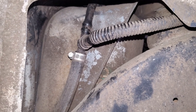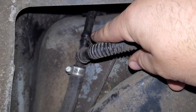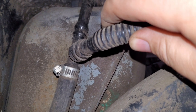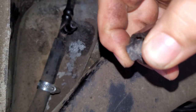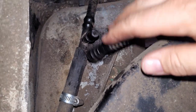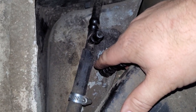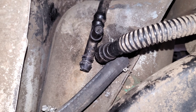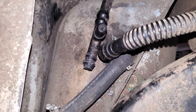So now we're in the passenger side wheel well. There used to be a quick connect there — it's gone. That may have been one of the sealed lines; either way, that's not original. There's a little quick connect we're going to try and get off in one piece. You just squeeze those two little wings together and it pulls right out. There's a little bit of WD-40 on there to help lubricate it. That other one there is looking like it's going to be a pain. Judging by how it looks, that used to be a hard plastic line also — whoever did the tank the last time probably broke it. But we got that off; it wasn't very easy, kind of a struggle, but we made it.